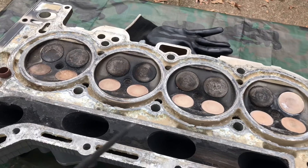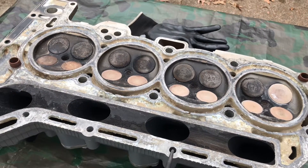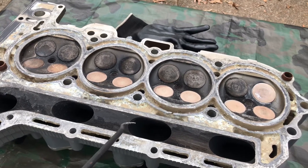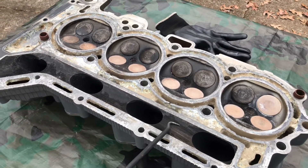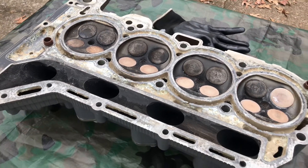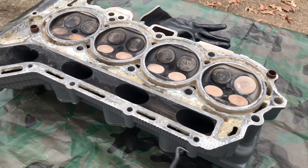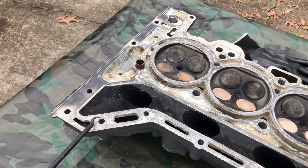I went to the schema and I realized that everything on the engines was the same from 2008 through 2020 — maybe still is. Same engine block and everything. The only thing they changed were the camshafts. So the head fit directly on it perfectly and bolted right on.